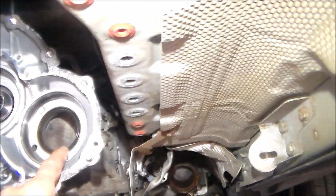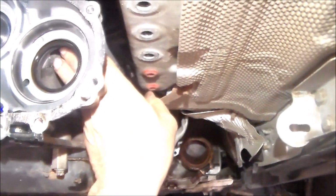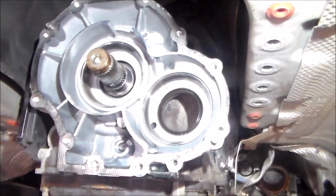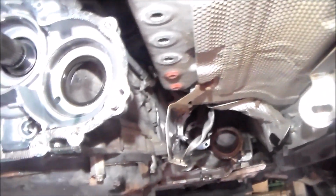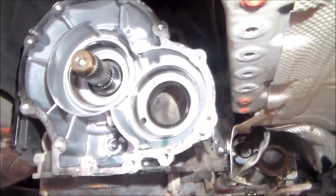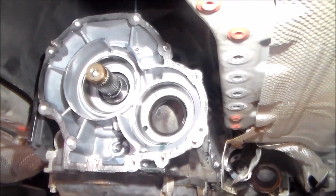All right, this will knock right out. The drive shaft piece will go through here, and the drive shaft is going to butt up against this right here with that rubber boot or that hard plastic boot. Then we got to look for the master spline and slide the piece in, and at the same time I can back out and slide that piece in and put everything together. So that's that, and we're going to head back to the bench to finish it up.